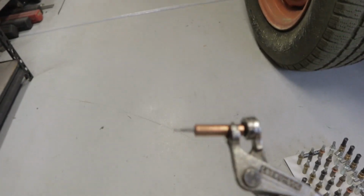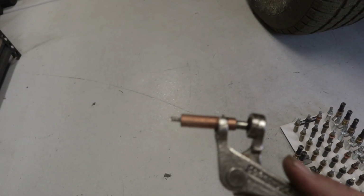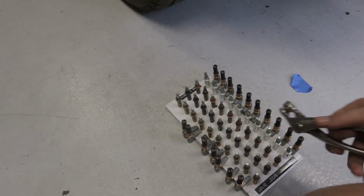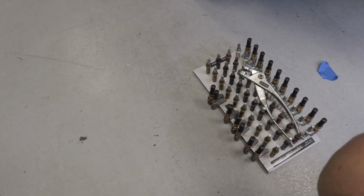Guys never seen these things, these are really cool. They're really helpful. Use these a lot building the Cobra. So you drill an 1/8" hole for rivets. You can stick that in there and it'll actually hold. Then you don't have to rivet right now, but it allows you to take it in and out and all that kind of stuff. You guys will see us use those later on in more projects.